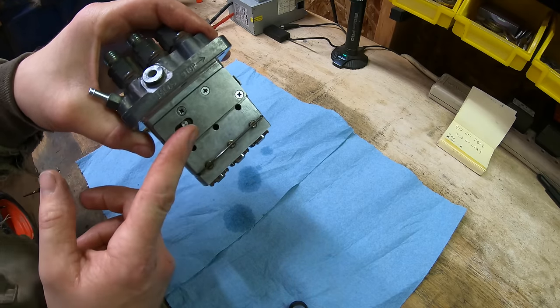The tamper-proof Torx screws to remove the barrel were not needed — a light knock caused the upper plunger piece to slide right out of the barrel. So no further disassembly is required beyond what's already done. The same process needs to be repeated for all three cylinders; you can't access the middle one without removing the end ones, so all three are fully disassembled.